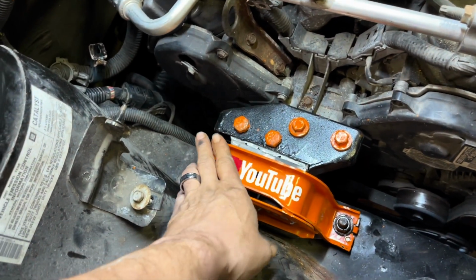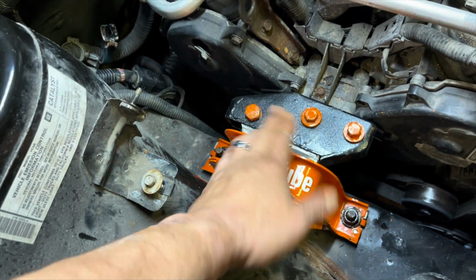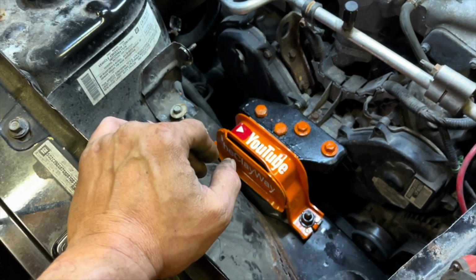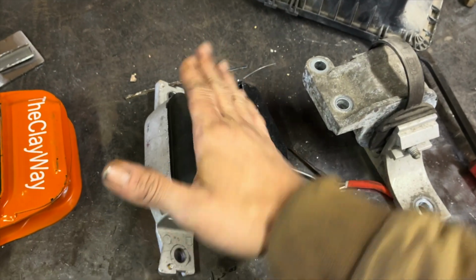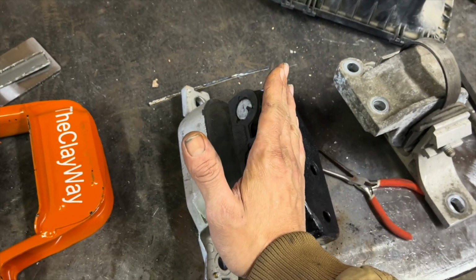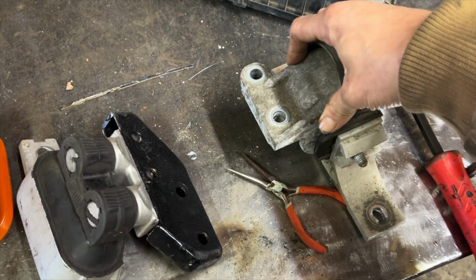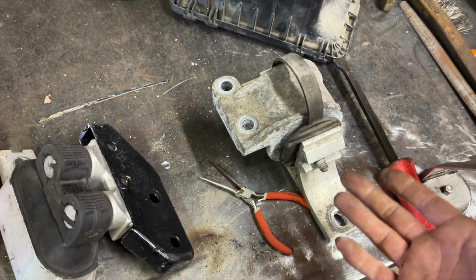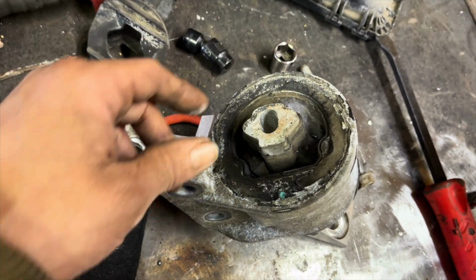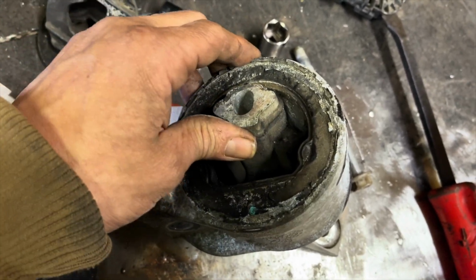Now, mine is going to take the torque and move it in between these 2 posts right here so that engine can't move as much. That's why mine's so much more superior than the original one. How mine differs is the torque goes right inside here, and then this bar stops that torque at a certain point. And it's a hydro mount. The original ones, there ain't nothing holding that. That's why that is garbage. See, absolutely nothing there except for some garbage rubber that's definitely going to break if you drive your car. Forget about even getting into the pedal, so this won't do.